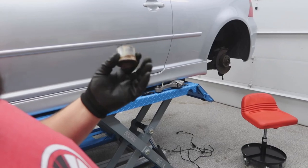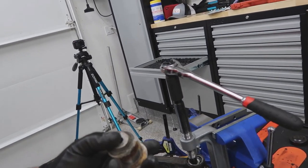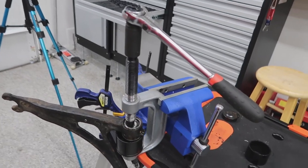Of course, running into an issue. Let me show you what the other bushing looks like — it's a rubber bushing with a metal encasing, and the encasing is a bit rusted. I don't have a piece to push around the metal, so I was just pushing the actual rubber piece, and this one's starting to separate. But I need the metal casing to come out. I just sprayed some PB Blast in there and let it sit. I need to find a socket wide enough to push on the metal — that should help.